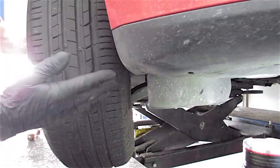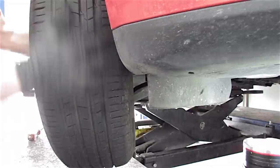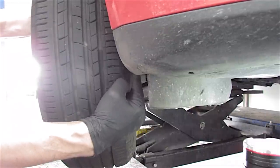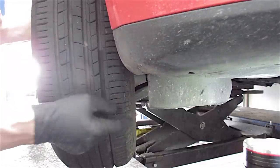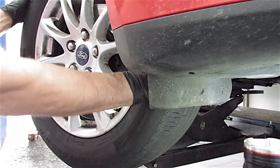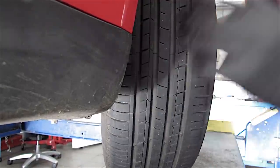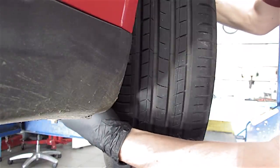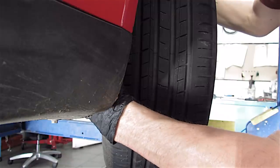This one's actually okay. Everything's all right, and suspension wise you can check your tyres, check your inner CV boots, just have a good look inside there with a torch for anything that could be out of place or chafing, especially brake hoses. Then turn your wheel right the way around the other way and rock your wheel again at 3 o'clock and 9 o'clock to make sure there's no play in anything. Check your steering rack gaiters, your ball joints, the little dust covers on all your ball joints, or any wiring, ABS wiring that might be out of place.